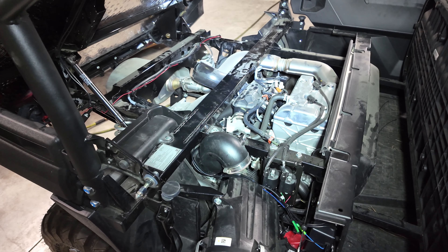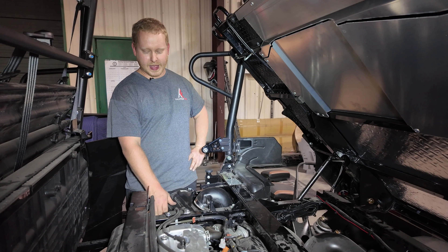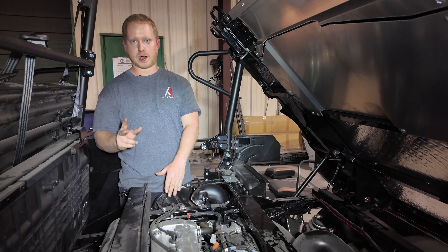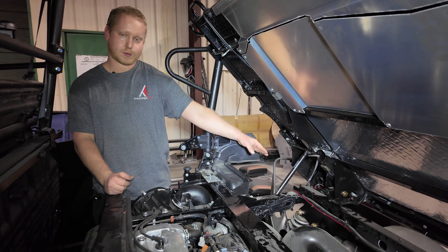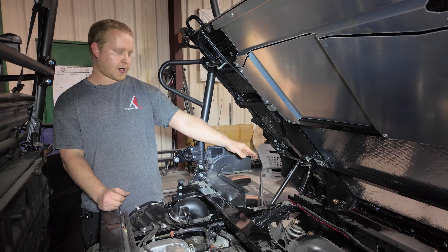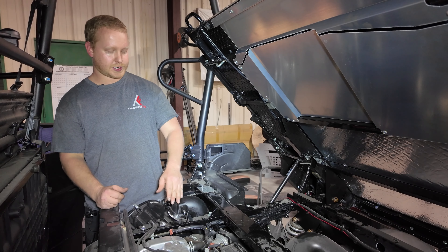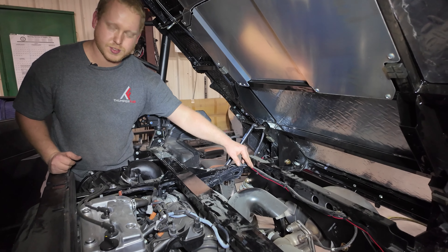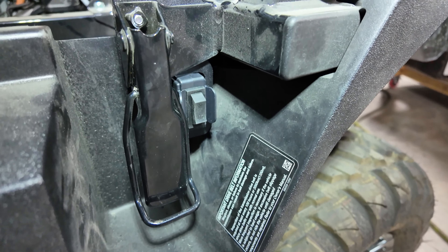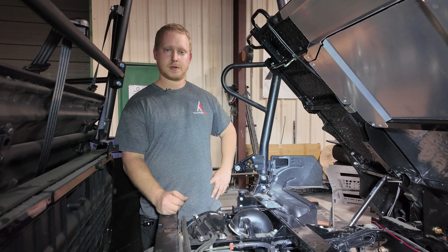For an overview of the wiring on our headache rack for a Kawasaki Mule: first, mount your winch contactor box on the inside of the battery panel and run the battery wires from the contactor box to the battery terminals, before running the winch wires from your winch contactor box back towards the passenger rear brake light where we mount our junction box. After that, tie in your jumper wires from the winch to the wires from the contactor box at the junction box to allow your bed to tilt back and forth. Then run the wiring harness for your switch down the passenger side frame rail, zip-tying it to the O2 sensor harness before coming in to the rear driver's side panel where we mount our switch. Make sure you zip-tie everything up and keep it away from any hot or rotating components.